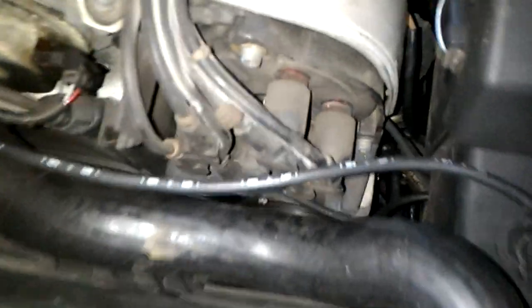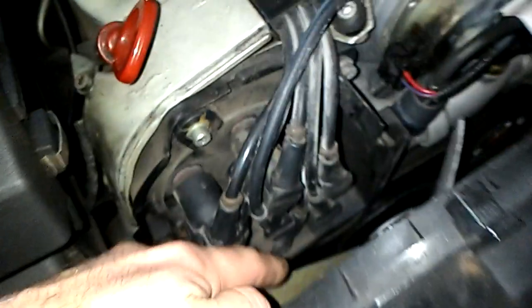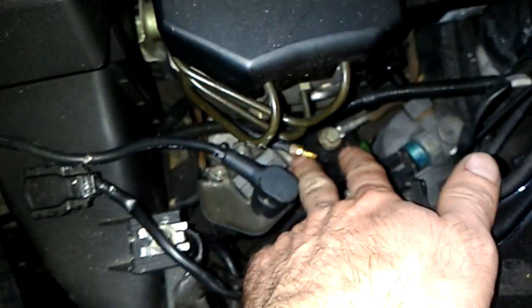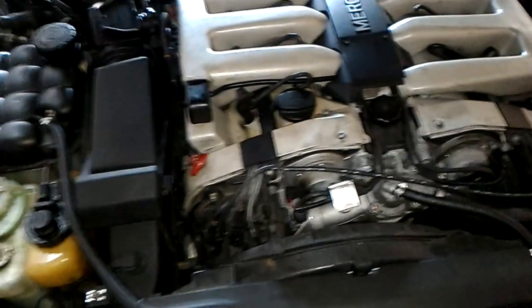The second problem is caps and rotors — they're in terrible shape. This one is completely messed up, burned on the central electrode. And this wire that runs under and over, it just snakes through — under the caps, under the water pump, runs along, and comes out through the coil. This cap is still messed up, very loose, and burned inside. It's not a good cap at all.